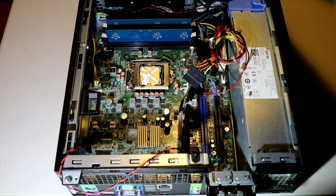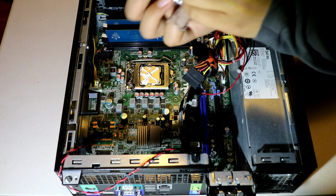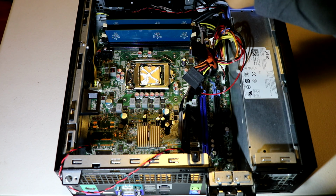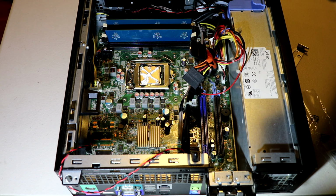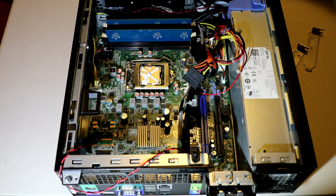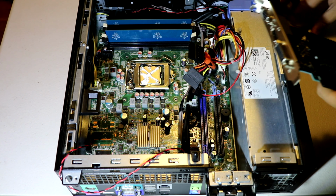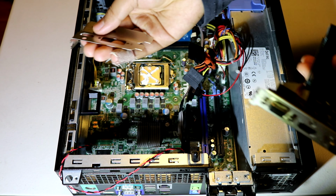The ASUS, I'm very sorry, but I have lost the clip of me installing the SSD. So I'll give you a basic summary. I got the SATA cable and the SATA power extender, did some cable management, then I got some double sided tape, then taped the SSD onto the power supply. So it sticks tight, and as I was saying, we need to switch this out to a low profile bracket.